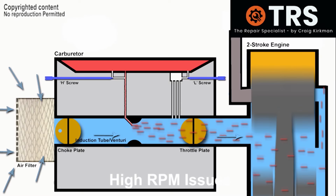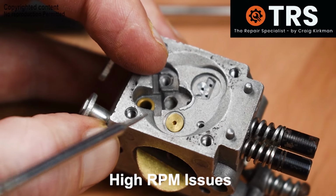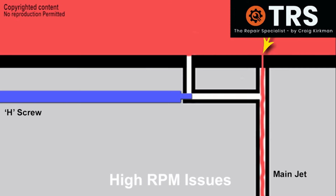So to understand how that corrected the problem, we need to look at how the main jet's fuel adjustment system works. Fuel is drawn into the main jet out of the metering reservoir above and down into the venturi. But the amount of fuel that goes this way has to pass through a very small orifice at the top. And we can see just how small this orifice is on the carburetor itself. But the amount of fuel that can pass this small orifice may be adequate for idling revs, but it's not enough for maximum revs. A supply of fuel from this hole alone would cause the engine to bog when throttling.